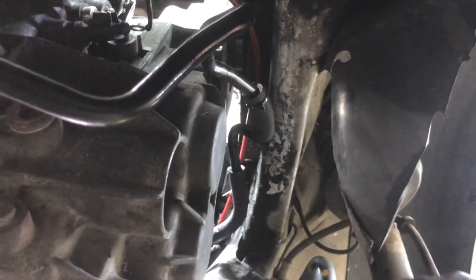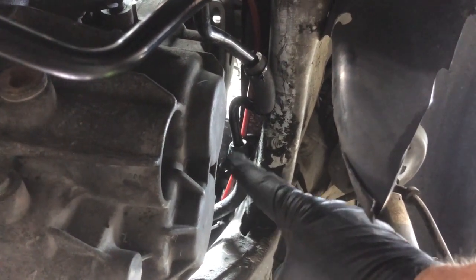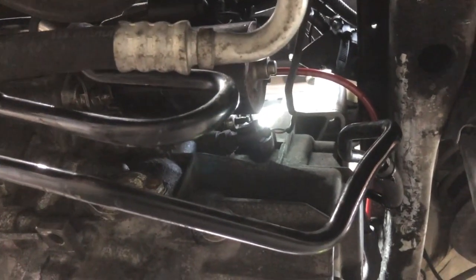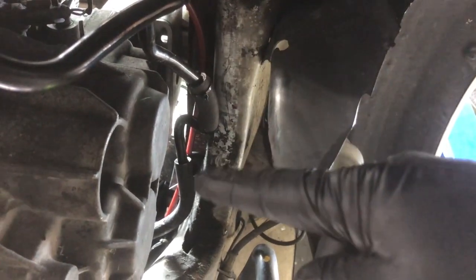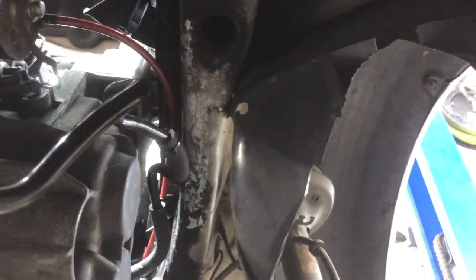All right, so I'm going to put one more clamp. There's a hole here for a 13mm nut that I can bring a clamp out and hold that in a little better position. So it can be frustrating, and you got to play with it and bend it a little bit here, open up that bend a little bit there. Obviously, if that piece was straight, this would be a lot cleaner and a lot easier to do, but that's designed to come up over the transmission and around something and then come down the front of the transmission. So it is doable. You got to play with it.